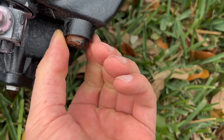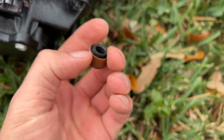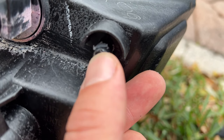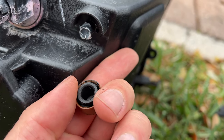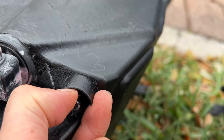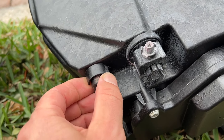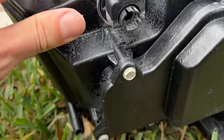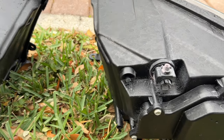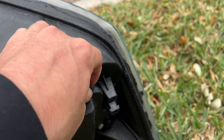Going over to the headlight that doesn't have condensation, you can see the cap is not pressed all the way in. What people are doing is backing these off — putting them on just enough to not fall off — and that resolves the issue. Even worse, this one has been completely siliconed off so it can't even breathe whatsoever. This person jammed silicone into the cap to seal it off even further. He's completely gone bananas sealing these headlights off so they can't breathe at all.